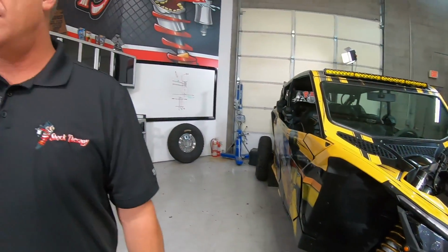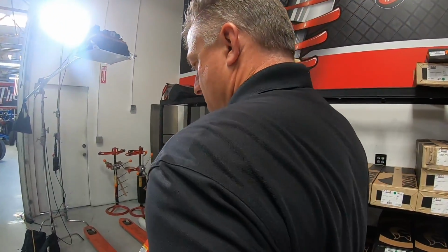I got Justin Para 55. What is the largest offset you can go with 33-inch tires on a Turbo S? I would do 5.2. I would not do a 4.3. That's too much. So stay with a 5.2 or less.